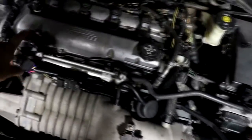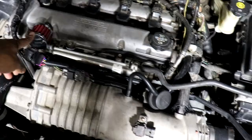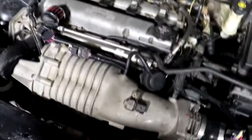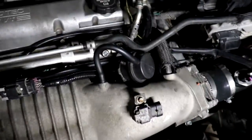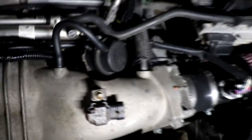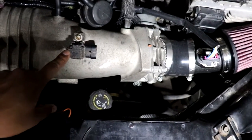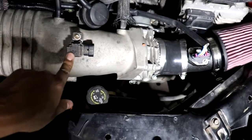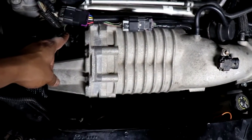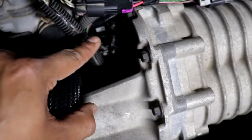Since we're no longer using the factory hose going to the intake, GZP supplied a breather filter that goes on the valve cover for that port. The bypass valve is hooked up and the bottom nipple vents to atmosphere, so it doesn't need to connect to anything. The stock MAP sensor also won't need to connect to anything — I want to make a block-off plate for that. For the 2.2, the MAP sensor is located right there.